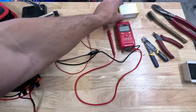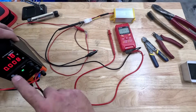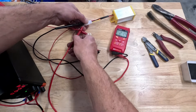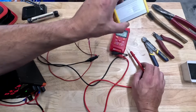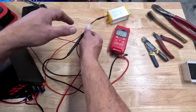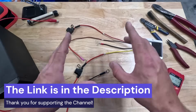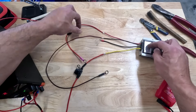Let's talk about this converter. Always check your voltages — I hooked up 52 volts to this first converter and tested the voltage coming out: 21.4 volts. That's very bad; it's supposed to output 12 volts no matter what you put in between 36 and 72 volts. So it's not converting the voltage correctly. This other unit is a bit more robust — you can get these on Amazon. The wiring is simpler and they have a wiring diagram included.